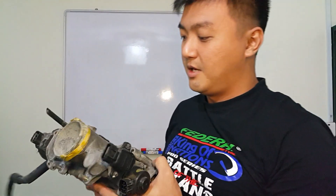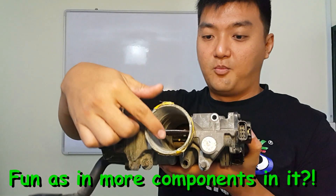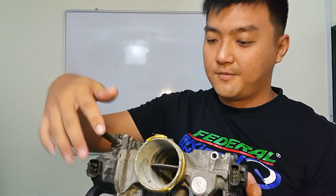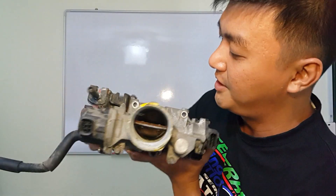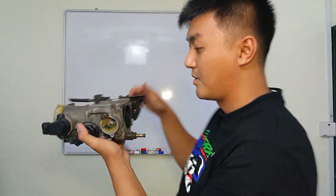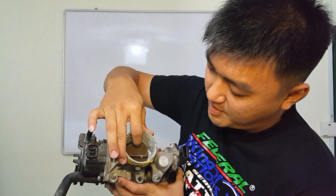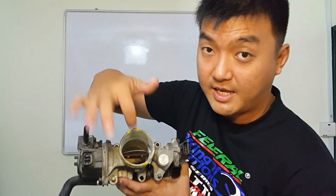I've got another one that is a bit more fun. This one is originally open, and when it senses any traction slippage it will close by itself. There is one butterfly valve, but inside there is also another secondary butterfly valve. This inner butterfly can reduce airflow even if you're at full throttle — it will reduce your air intake.